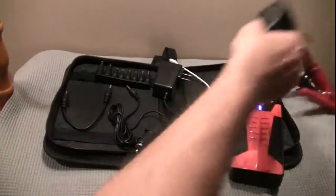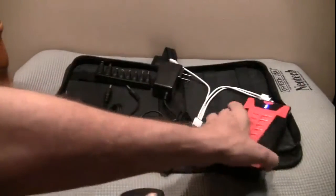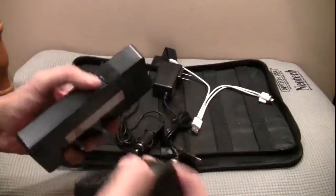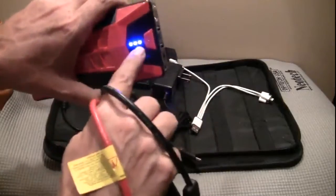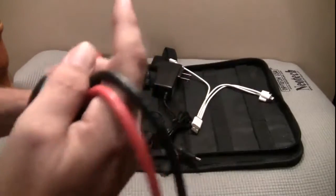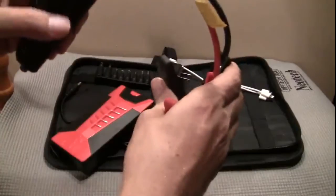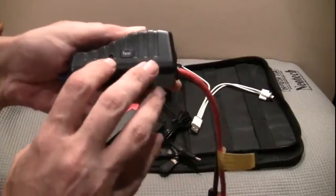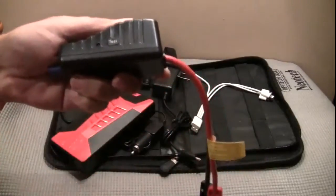As for the car battery jump start, I looked at the instructions — I'm very careful about reading instructions. The operation is pretty simple. Peel back this little flap, stick it in, and you want to have your power bar up to three — in other words, make sure it's full before using it as a car jumper. You plug it in, stick it on your terminals, and then a little green light comes up as soon as you get a good connection. It didn't for me, but if you hit the test button it comes green, so it's good to go.